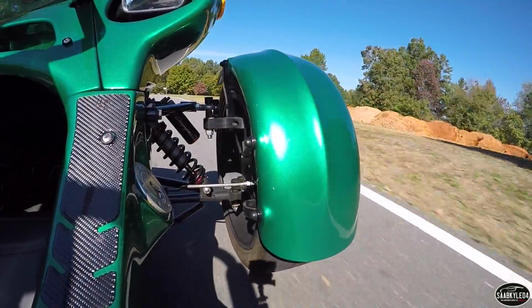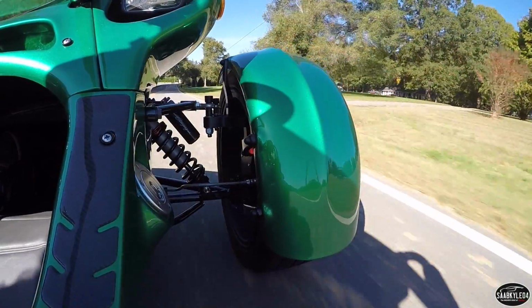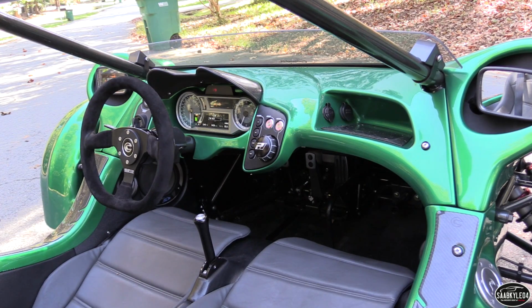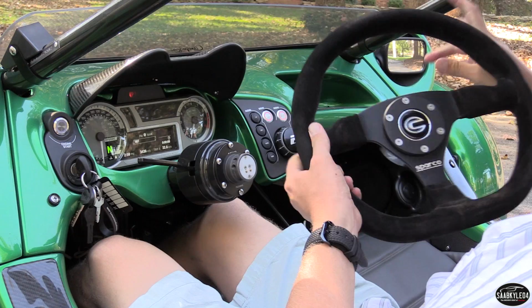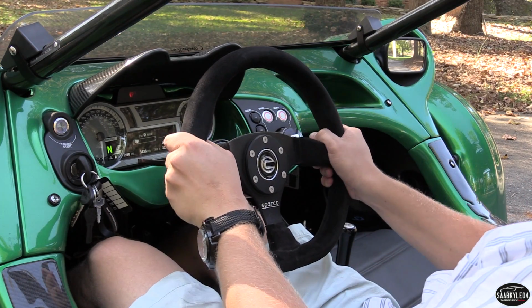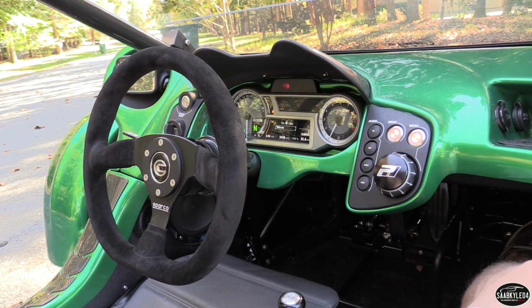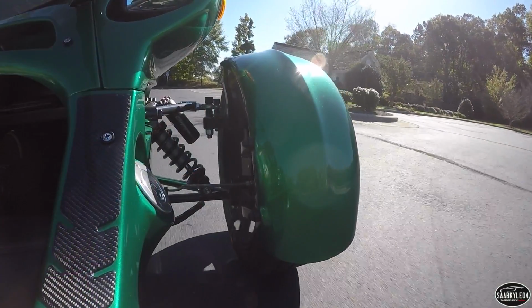The 16 SP also gains a more direct steering system, courtesy of a shorter ratio rack and pinion, in order to enhance precision as it responds even quicker to your inputs. A flat-bottom Sparco steering wheel is also added for a racier feel. It's wrapped in Alcantara, measures 13 inches in diameter, and features grip bolsters at 10 and 2. The steering is completely unfiltered as there's no power assistance. Since it doesn't weigh much, low-speed maneuvers are much easier than you'd think.